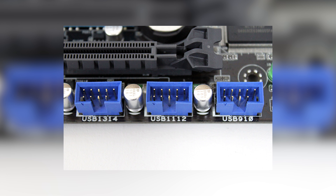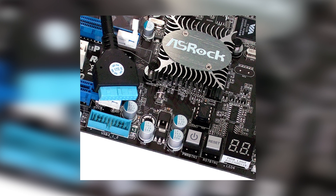I'm almost a hundred percent sure that all motherboards have these on them. So if you have recently replaced your motherboard and you notice that the USB 3 ports on the front of your computer don't work, you may need to open your computer to check if the cable for those ports is even plugged in.